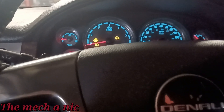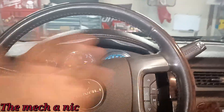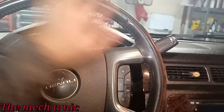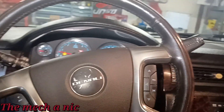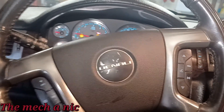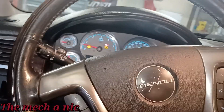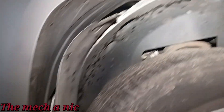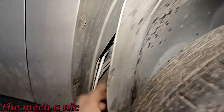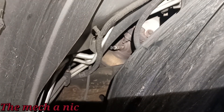The truck does start much better now. But I caught it again — I let the truck sit a minute or two, then started it up and it didn't want to start. Crank no-start, and then on the second attempt it started right up. Going back to my original theory: fuel pressure. I raised up the truck, put a jack stand underneath for more clearance, removed the fasteners holding on this side of the fender liner, and there's our upstream oxygen sensor right there.